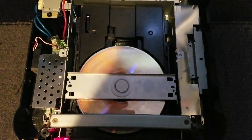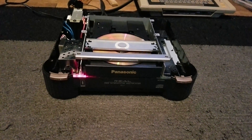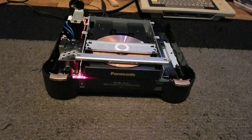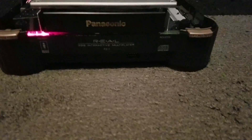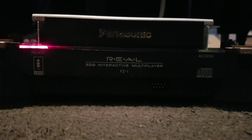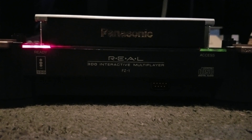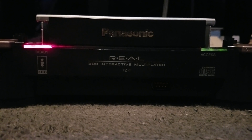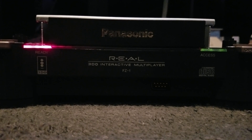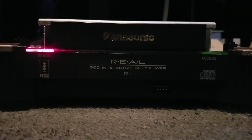If you have any thoughts or ideas on what to do to get this unit working, please feel free to give me tips and advice — if there are any particular voltages I need to read or anything like that. I can't find any schematics online, but I'm trying everything that is known. You can see the difference in access light intensity, it trying to read with no disc, and that slight constant blinking like it's trying to load something but can't. I'm not sure if the BIOS is messed up or some sort of EEPROM or ROM, but hopefully I can eventually get this thing working.